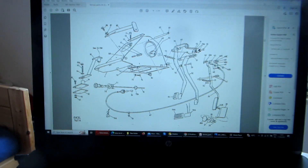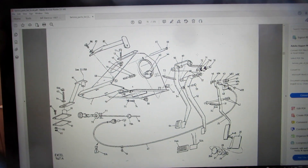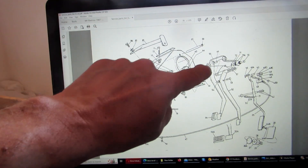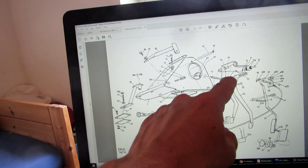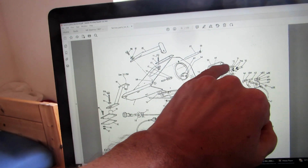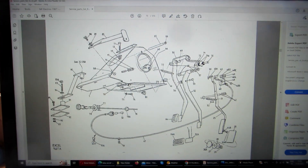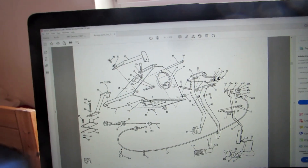Regarding the bent clutch lever, I've done a little bit of research and the only documentation I've got for any aspect of this car is basically a service parts list - a PDF document on the computer. This is a split diagram of the clutch. This is the clutch pedal, connected to this rod here, which fits in there and is connected to this lever here, which is also connected to a push rod that operates the clutch master cylinder.